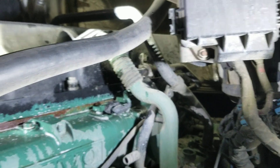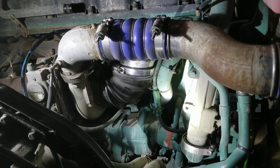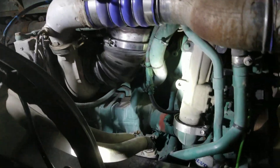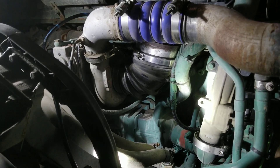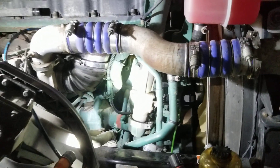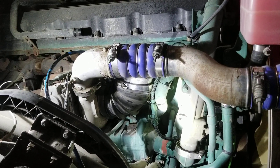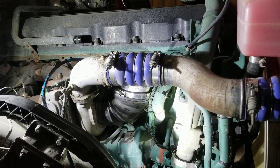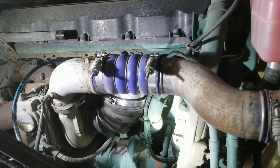Go back to the intake manifold and spray all the way to where it stops. That's a pretty simple boost leak check that could save you probably thousands of dollars in fuel. After you make the tool — or you can buy it online, there are guys selling it — you can install it and use it yourself. If your truck is consuming too much fuel, getting constant regens, or has poor fuel economy, this will help you out. A boost leak is the number one thing you need to check if you're having regen or power issues. Thanks for watching, hope this helps.